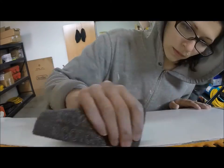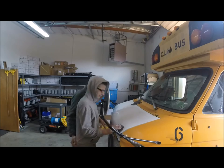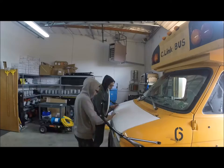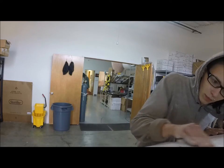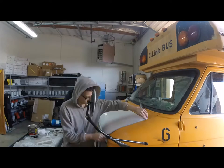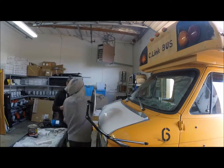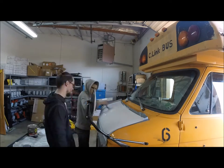When it comes to painting the bus, most of the work is in the prep. If you've been following along, you know we've done two coats of the rust inhibiting primer, and today we are adding a second coat of the tractor and implement paint slash enamel. To tape off the section we aren't painting, I used a really low adhesive duct tape that I got for a discount — it pretty much only sticks to itself and hardly at all to the bus.